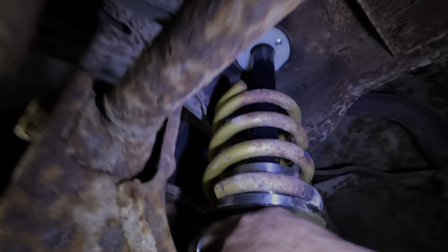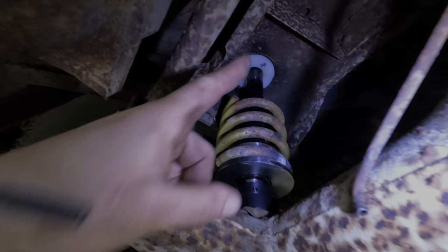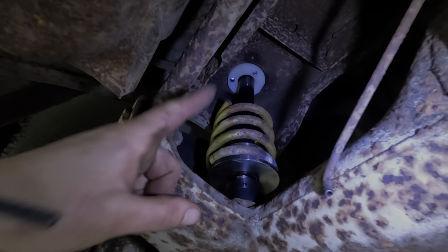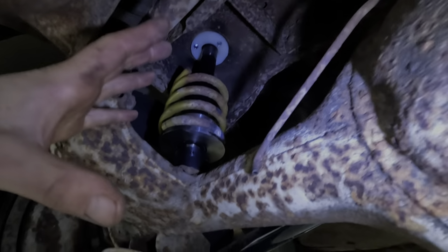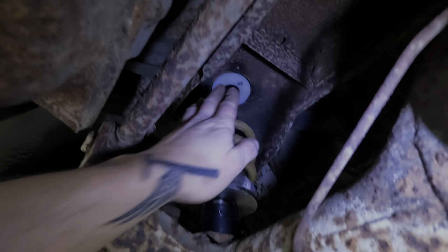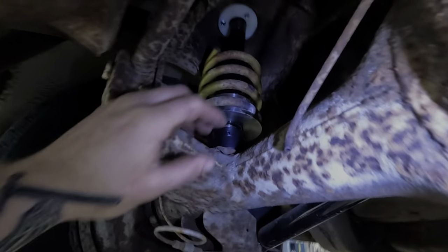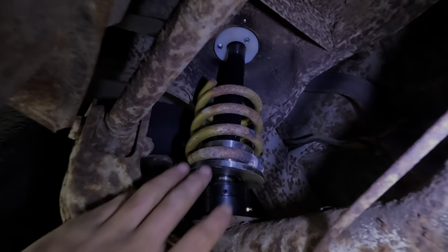Okay, so those donuts are here to isolate that cylinder before we put everything together. Kind of semi-inspired by Christian from Cruisewell Manufacturing. He's got a sweet situation for this that we just didn't order. We weren't even thinking about it at the time, but it would have worked perfectly here. So I just used some half-inch nylon. Benny cut them up into little donuts here to isolate that cylinder, and next is to weld on the power ball, and then these coil over hydraulics will be done.